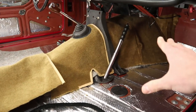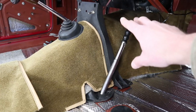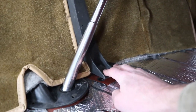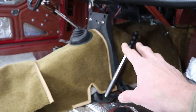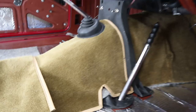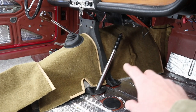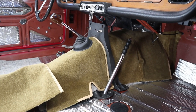We've got our carpets kind of loosely fit into place, just making sure we know where everything goes. Some people have had issues getting their center supports over the tunnel with all the carpet and underfelt in place, but to me it doesn't look like it's going to be much of a problem. With some bolts I think we'll be able to squish it down, so we're going to leave all of the underfelt in that area for now — some people do cut around that. The first thing we've got to do is get this underfelt attached to the transmission tunnel cover, and then figure out where all the little snaps go that hold the carpet onto the tunnel. So we'll start with the jute, then we'll be moving on to snaps.